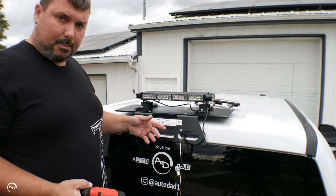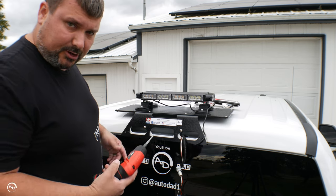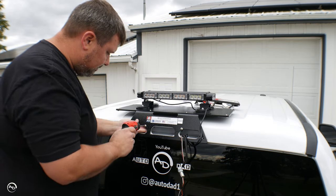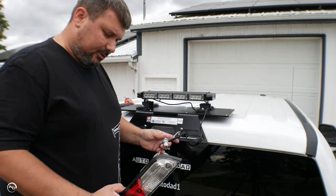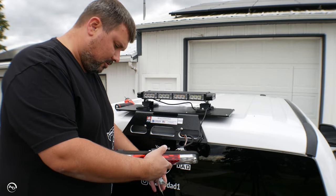One very important thing to remember as you're tightening these up: make sure your holes stay aligned, or else you'll never get your third brake light back in. Looking pretty good — it's got a big gasket, nice and sealed.